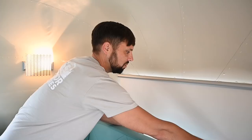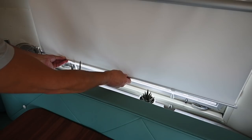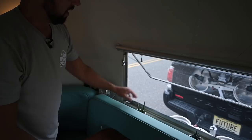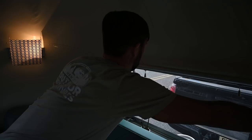There are also Oceanair roller shades. Newer-style Airstreams have these — they come down and hook into a recess on both sides to keep the shade down. Pull down and lift up to release. To open the window, pull in the hardware and wind both window levers — this is the insect screen, which is fully removable by twisting the little tabs. Behind there I have weather stripping so bugs don't get behind the screen. Wind both handles evenly to close — one side's faster than the other if you're not even — then lock it in place.